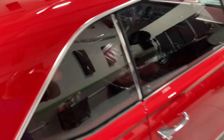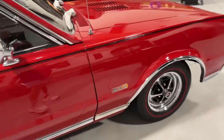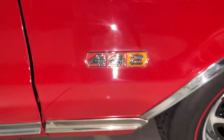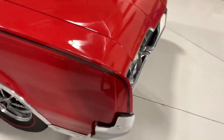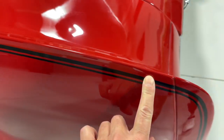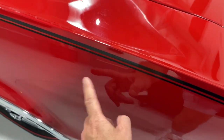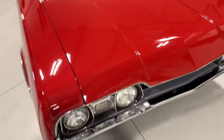Some people look at this and go, wow, that's a really beautiful car. But a trained eye from an experienced detailer — we look at it and think, no, it needs some help. It's a show car; it should look like a show car, and right now this does not look like a show car. Also, this has painted-on stripes. So of course when you're buffing, you want to be very careful not to buff on top of them because usually the pinstripe paint is softer than the actual paint. Anyway, time to get polishing on this thing.